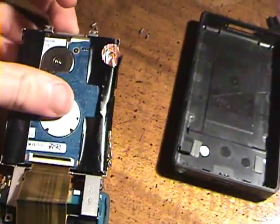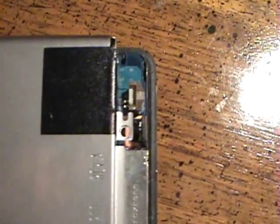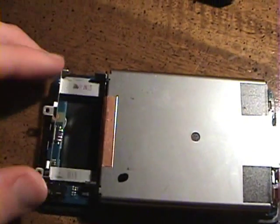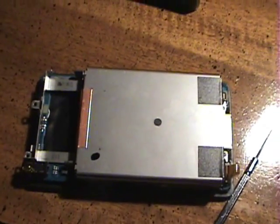We're going to take this, which is the hard drive — a 60 gig hard drive, which is what we're putting in. Carefully — I don't know if you can see in here, but there are little pins you want to make sure to line up, and then you want to screw the hard drive in via four screws. So I'm going to do that step and then we'll be right back.